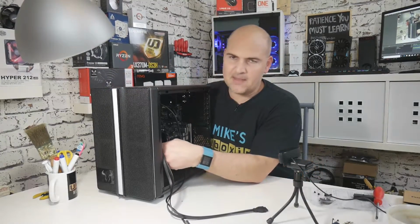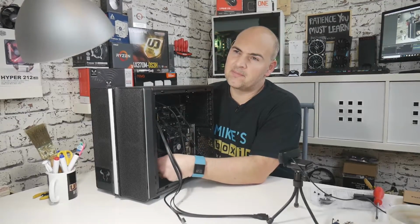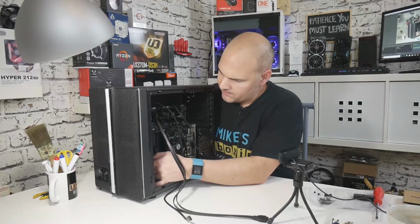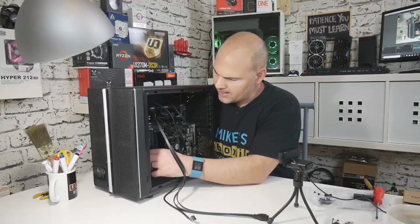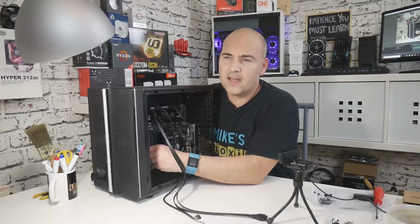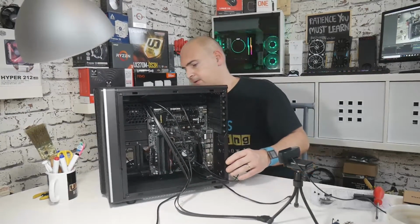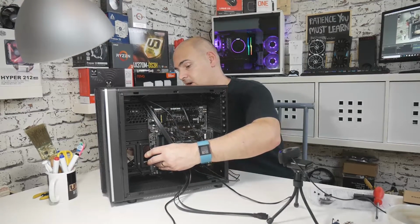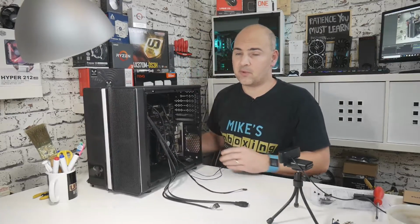If it's purely for gaming and stuff like that, then if they're the same price, I'd probably go with the 2600 because of the higher single core clocks, and also you can probably overclock it a little bit higher again. If you're going to be doing any form of content creation, then the extra cores and threads will definitely be useful on the R7. And actually the R7s you can overclock to quite a good level. So it really depends what you're using it for.